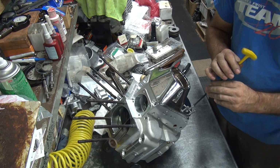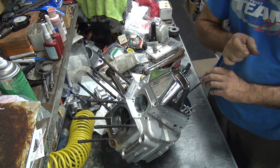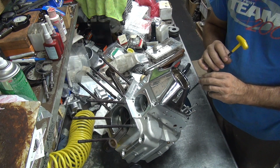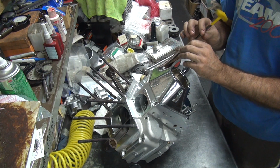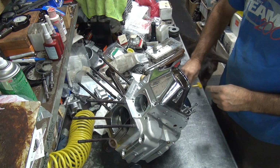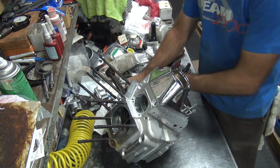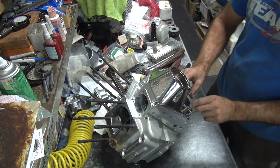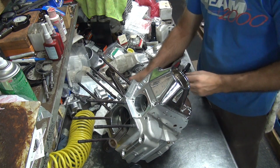If I put a looser gear on it again, a looser pinion gear, it'll get so loose it'll probably sound like loose valves all the time, the clicking noise you get. So you go from whining to clicking. So this will be a whiner on some of the teeth and then all right on the other, and then if I make it all looser to compensate for the tight one, it'll turn into a clicking motor probably.